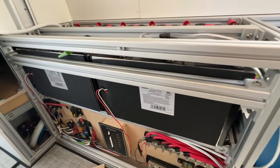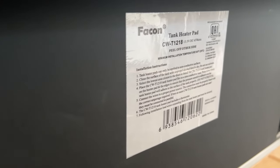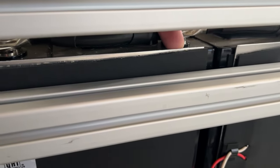For number four we have something that's not water related at all. It's actually two heating pads that I have installed on the outside of my battery bank to preheat the batteries. If you have lithium batteries, you cannot charge those batteries when it's below 32 degrees. These days you can buy batteries that heat themselves, but I bought my batteries before those existed and you can also save a lot of money by doing this. I basically bought the exact same tank heating pads I have on the water tanks but attached them to little sheets of aluminum, then mounted the aluminum with the heating pads to the sides of my battery bank.